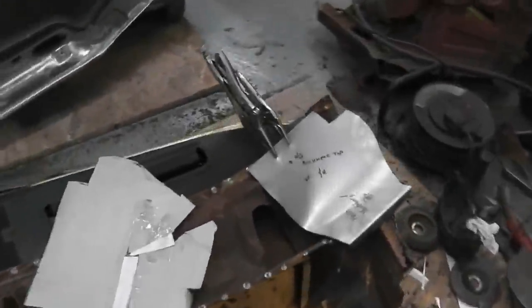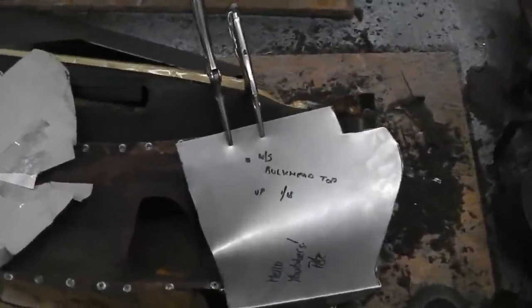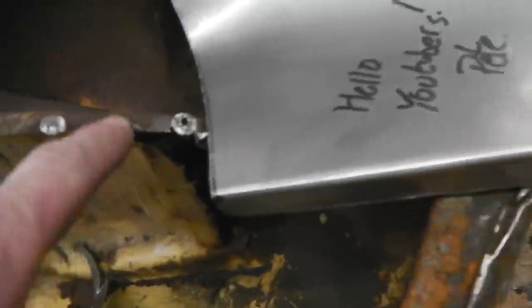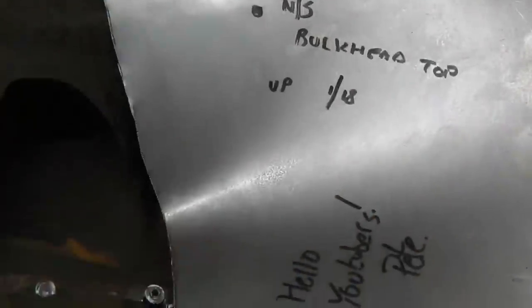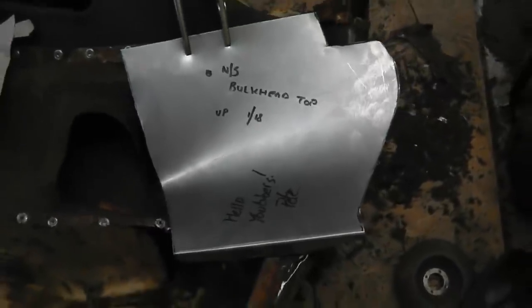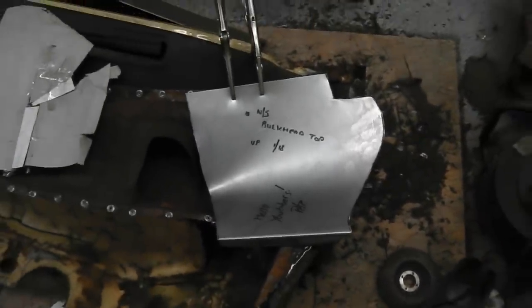We're lined up, clamped up, stamped up and ready to rock. So clamping up the top, this will start to curl upwards, hopefully. I've put a little edge on it now to continue that edge. We're now going to mark some score lines using this, so when I whack it, it's going to try and help and hit those score lines as well to keep the shape. It's going to take some persuasion, but we're confident it's going to go in okay. Here we go.